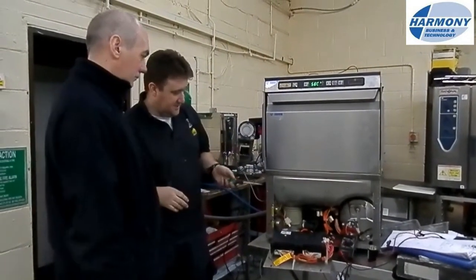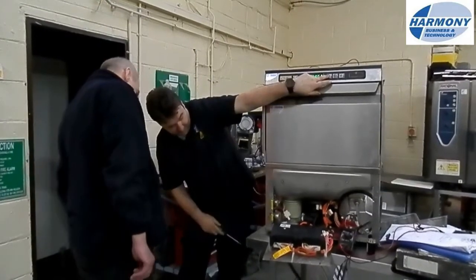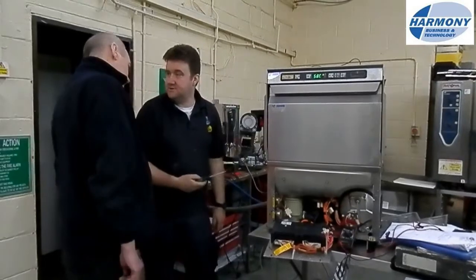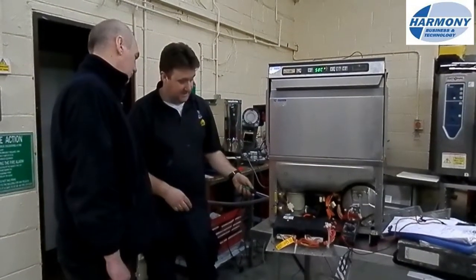It's gonna wash for a minute. As soon as I start washing, watch the detergent pump. Put the detergent in before it washes — it does at the beginning of the cycle. If it does it at the end, it'll just go down the drain as well. That's programmable.